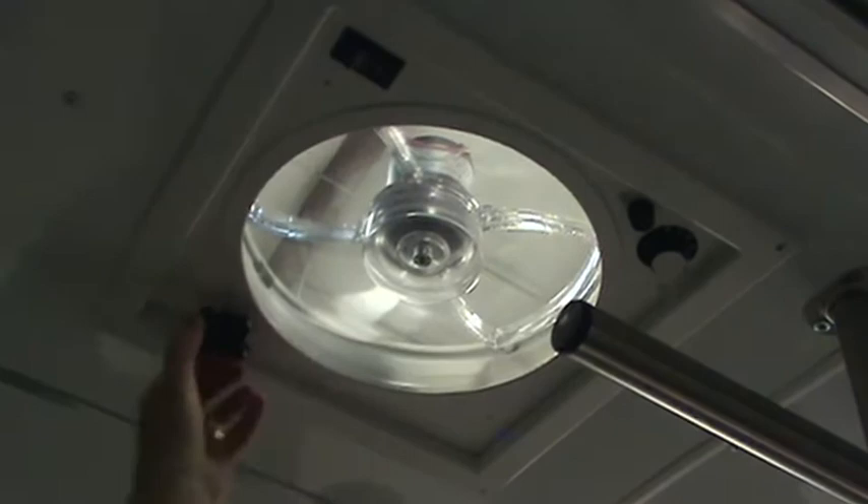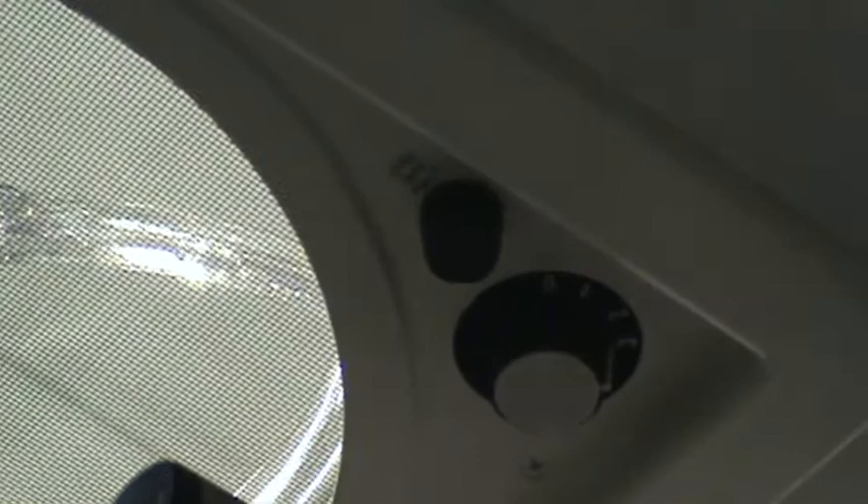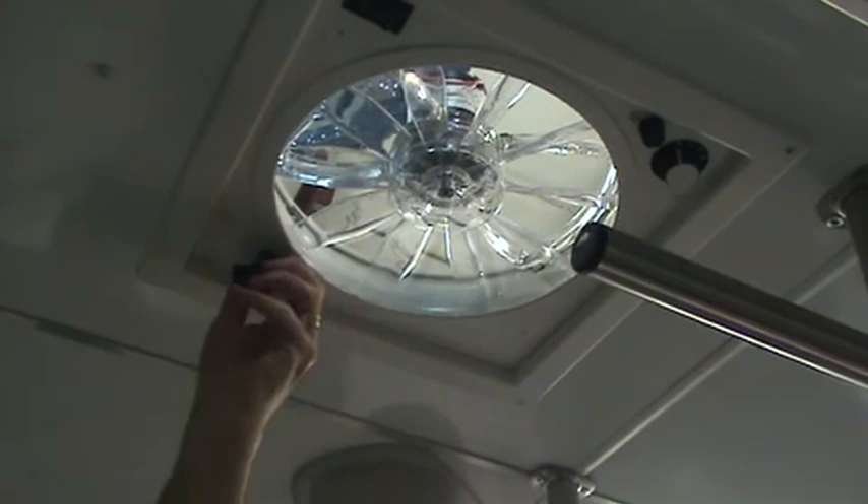You have a direction control — word of caution: don't change the direction switch while the fan is operating. For example, if it's going in and you change it to out, the fan drive motor has to immediately reverse direction and you could blow the fuse. Turn the fan off first, then change the direction switch and repower the fan. At freeway speeds you'll want the hatch closed due to buffeting, and common sense applies if it starts to rain — hopefully someone on board can get the vent covers closed.